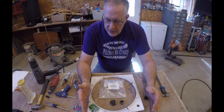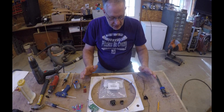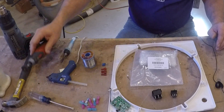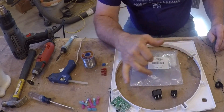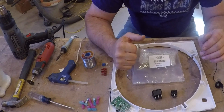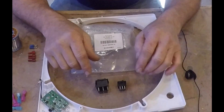The most important phase is rewiring this control fascia. I'll go through some of the tools I needed and parts. Here's the controller frame. I've got several different quick disconnect connectors. I have a glue gun used to stake the wiring down, a Dremel tool used to saw the hole to mount the switch, and a soldering iron because I'm going to do some soldering work on the connectors — you don't have to, it's just cleaner. I have a new controller board — this one is burnt out. There are two different switches to use; all you really need is the switch, some terminals, a little bit of wire, and some tooling.